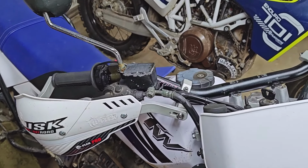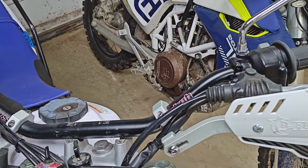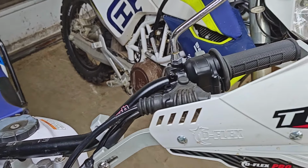So because of both the aesthetics and the clutch situation, I had really been considering sticking this Moto Bend on the XR. I think they might just look a little bit less, well, ape hanger-ish, and would only drop the actual control section a little bit more than 3/4 of an inch. The ATV High Bend bars have a 4.75 inch rise, and the Moto Bend bars on the TW had, I think, a 3.9 inch rise.